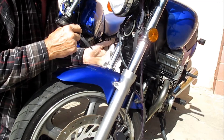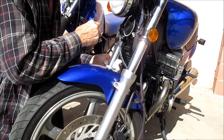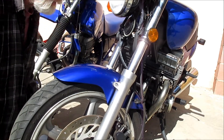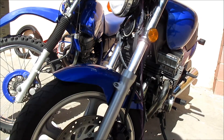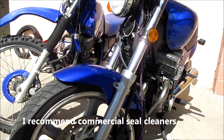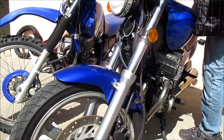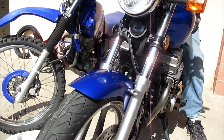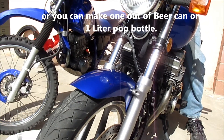There are about three lip surfaces on a seal, so if it's leaking there'll be oil in between those captured seal lips that has to work itself out. You can either ride it and wipe it, ride it and wipe it, or get on the seat and bounce it.